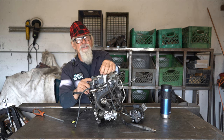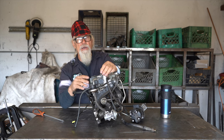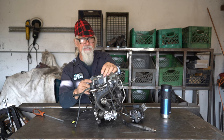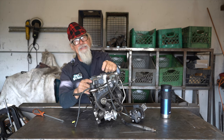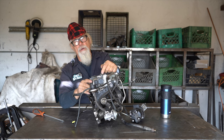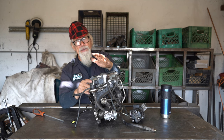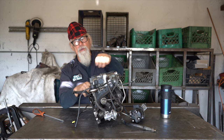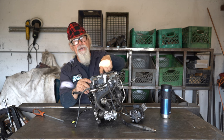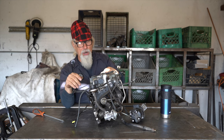Here's an issue we found on this engine that was supposedly rebuilt by another company - we're finding a lot of problems with it. Right above the TPS you're going to have your idle bypass screw. Something is horribly wrong with this one because the idle bypass screw is all the way out - it's supposed to be hidden way down in there with a little rubber plug. This is the only screw you can touch; you do not touch the idle screw. They've got a lock nut on it because this is all computer-driven. Don't try to adjust the TPS to make your engine run better, and please do not pull up this idle screw.